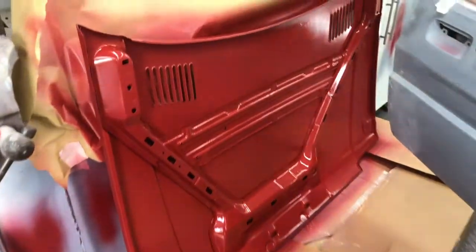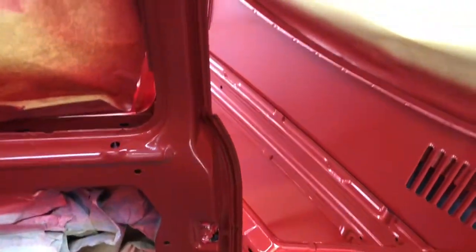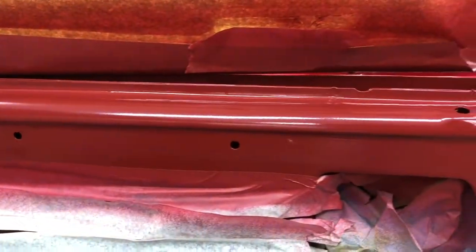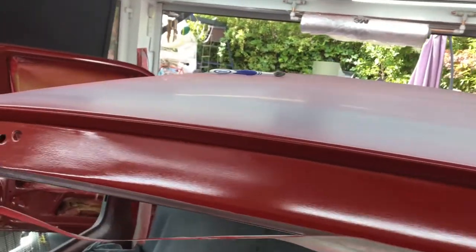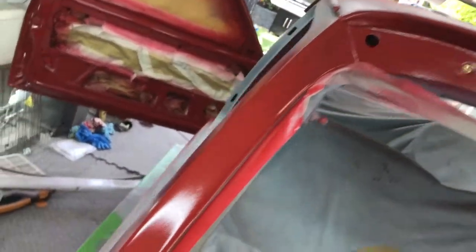For when I do the actual body, I won't have the doors open. The inside of the bonnet skin probably just wants one more coat, but to be fair it's got more paint on than when it left the factory. I've tried my best to get in all the door shuts, but the inner doors do need another coat — it's looking okay. There's a decent shine on it underneath the doors as well, and on the sill plates. I've given a dust coat in the fuel flap and I've decided to go around the tailgate opening as well. This has only had a dust coat and one thin coat on it.